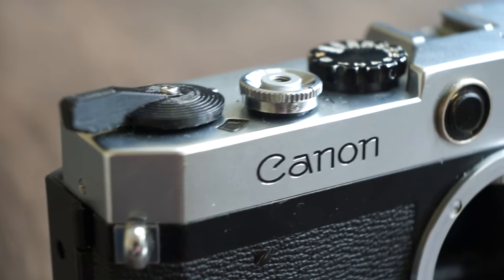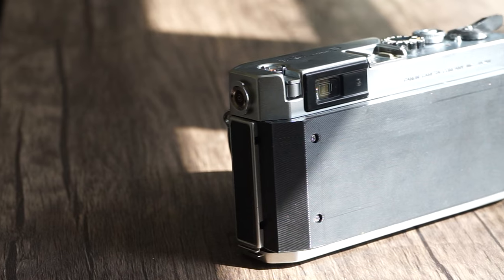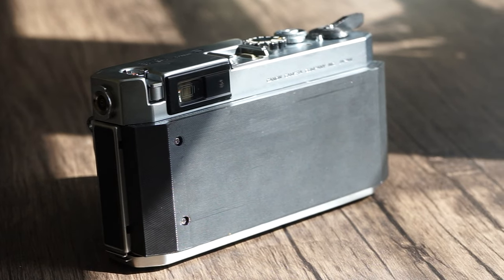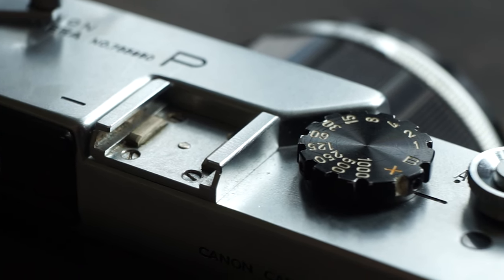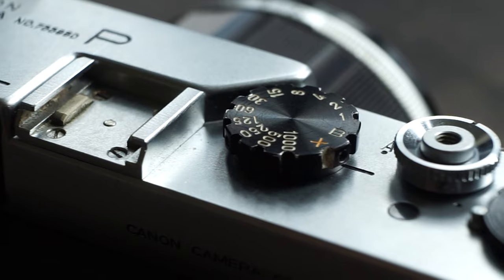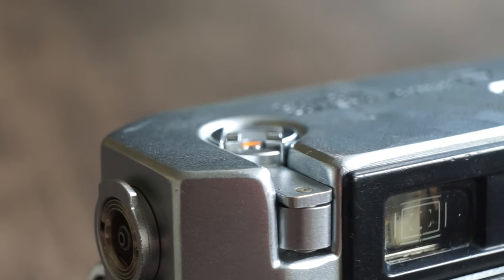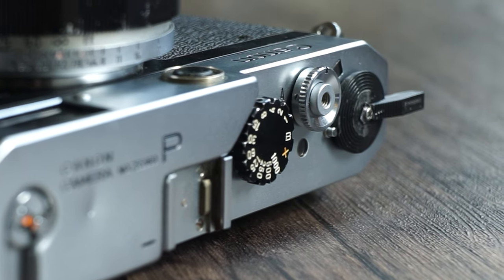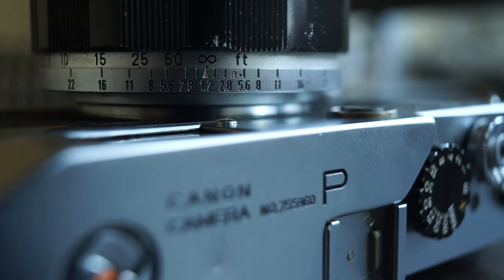I wanted to make sure this looks as original as possible and keep the retro feel, which meant I didn't want to put the screen or the buttons on the back of the camera. Rather than trying to hide them cleverly, I just didn't put them in. The disadvantage is that there are no buttons, so you can't change the settings — it's in full auto mode only, and I think that's okay. I wanted to use all of the original Canon parts: the timer lever, the film rewind lever, the shutter speed dial, the shutter button itself, the flash port, the hot shoe cover, and anything else I may have forgotten.